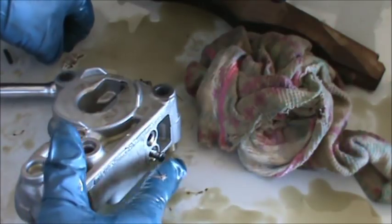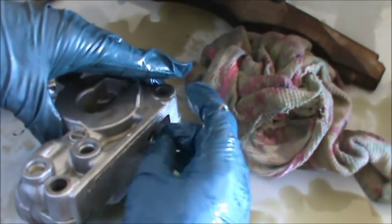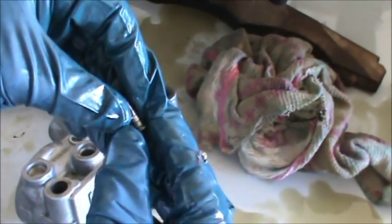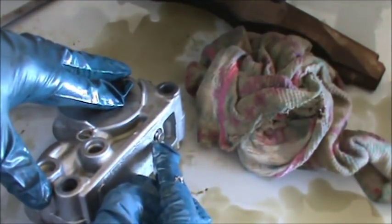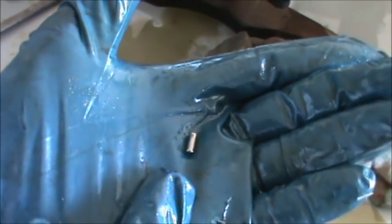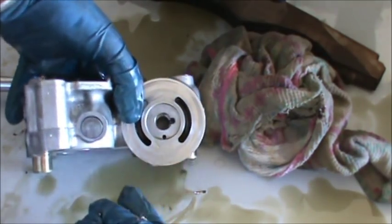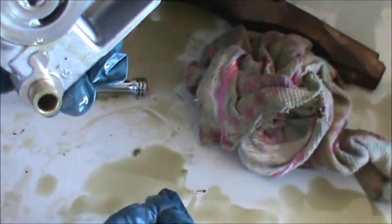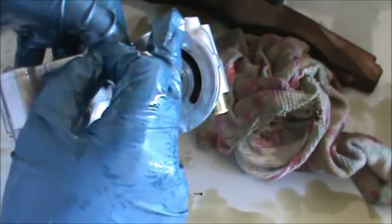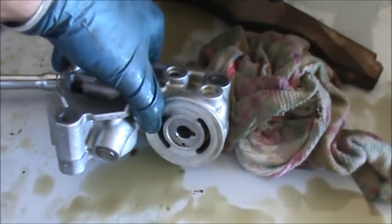I just lost a little ball — there's a peg in here and some sort of valve. There's a little ball that goes in first, then a spring goes in, and then this piece goes in the hole. These can pop out — that's how I lost that one. There's also a little tiny bead that looks like a Tic Tac; I believe it goes in that hole right there but I'm going to check the schematic. It's a good idea to print that out before taking this thing apart, which I did. The machined surface looks good — I don't really see much wear on it, so that's good.